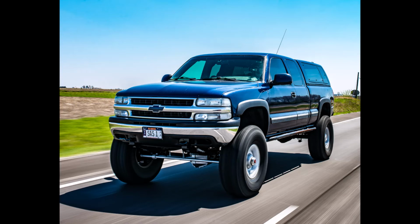Is that a full custom cage? I got it from TE Designs. It was a pre-bent cage, kind of built for pre-runners. I made some modifications to it because I wanted it more livable on the highway. So I wanted to keep the headliner for heat and noise. I isolated the cage to the frame with some poly bushings.